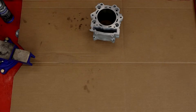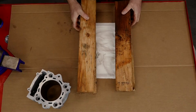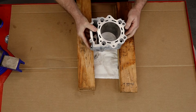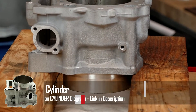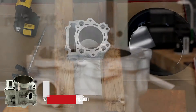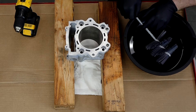What I'm setting up is just a little elevation where we can get the nylon hone to go all the way through and then back up. It's not really correct to call it a hone — this is more of just a cleaning procedure. If you look real close you can actually see the hatch marks that were already in there from the factory. We just want to knock off any high points, get it cleaned up, and then it'll be ready to go on the machine.